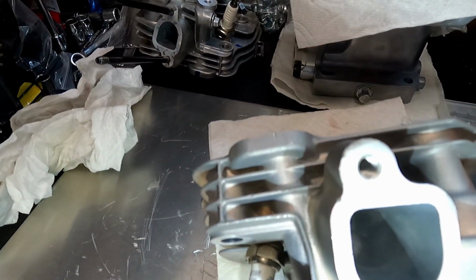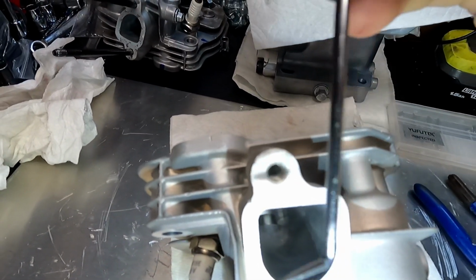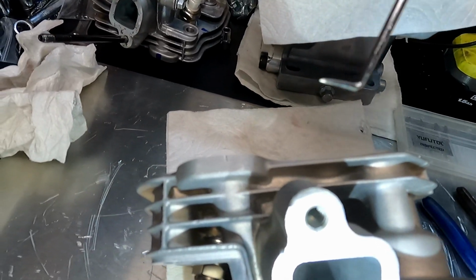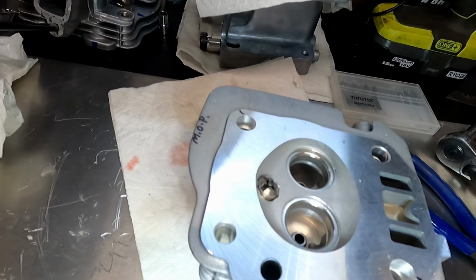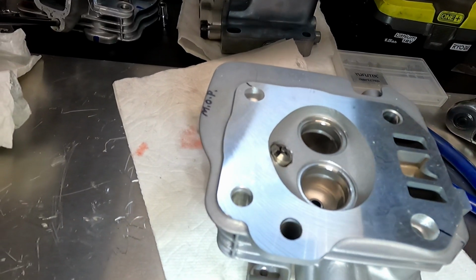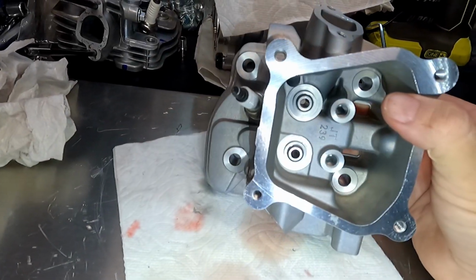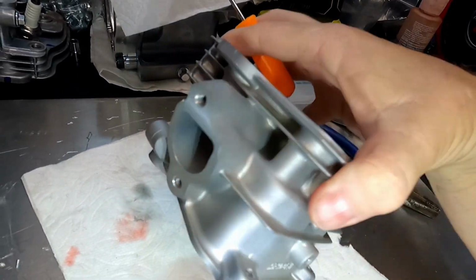I'm going to try to leave that intact because I want it to, as the air goes in, create a wall, and the air coming in on this side will create a Venturi effect, and it'll cause the air to swirl as it comes out of the valve, in theory creating better distribution of the air fuel ratio. So that's my plan. Let me know in the description if you think of something different, but that's what I'm going to do. I'll try to leave it as textured as I can.